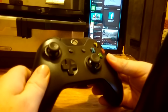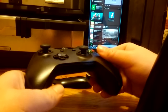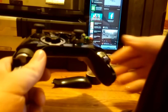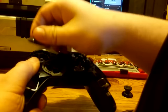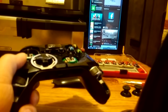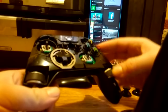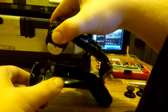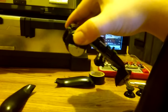I'm going to show you all how to adjust the joystick module itself. This is a little bit more complicated, but same principle. You're going to take the controller apart, unscrew those five screws, remove the rubber pieces from the joystick modules. Then we have to disassemble the controller a little bit more — grab to the left by the motors and lift up the controller from the backing, removing the back of the controller and setting that to the side.